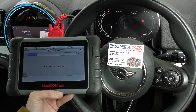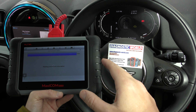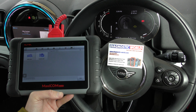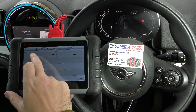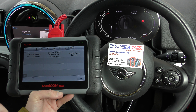So it's going to go to reading controller. If you're doing this with the engine on, it'll automatically turn the engine off and put the ignition stage back on. But in this case it doesn't need to do that because we're just at the ignition stage. So we'll go to diagnosis, go to control unit — we know we want to diagnose the engine fault, so that's in the drive option. Click on drive, click on DME, which stands for Digital Motor Electronics.